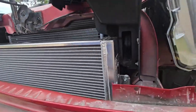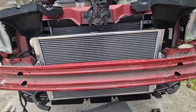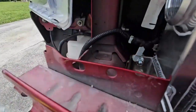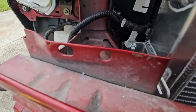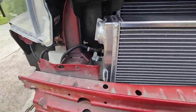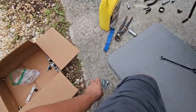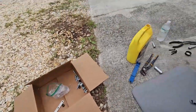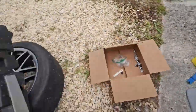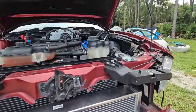That's how I trimmed it — she's in there, it's not tight but she is a monster. Here's my leftover stuff: I didn't end up using the little nylon spacers, and there are a couple of nuts and bolts left over — always handy for the hardware drawer. Reassembly is just the reverse: put the bumper back on, put your foam absorber back on, hook up your fog lights, hook up your hoses and intercooler pump, make sure everything's plugged in, and then you can fill your system.